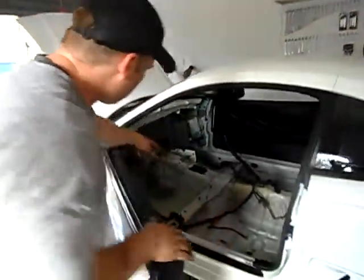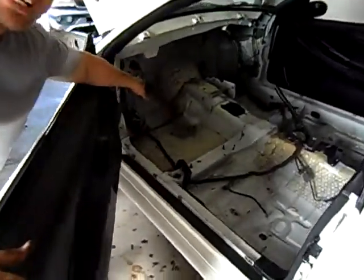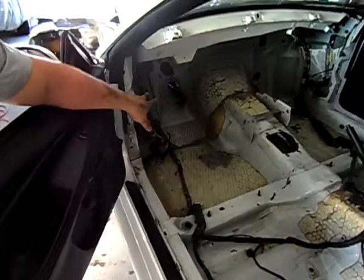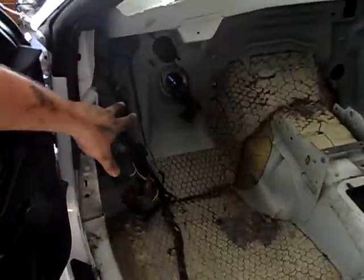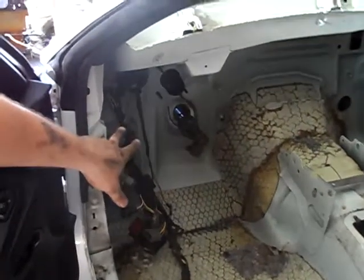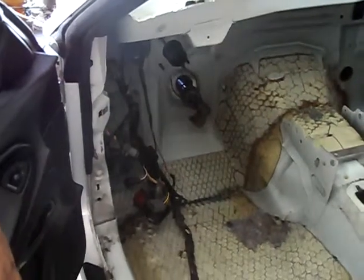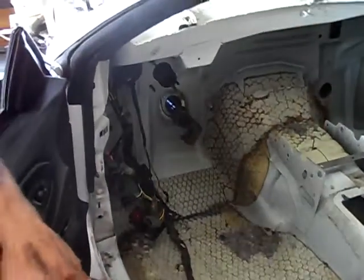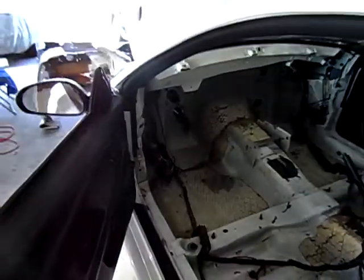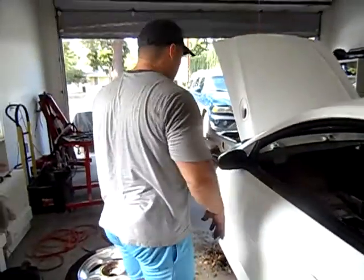We went ahead and completed pulling out the dash so we can expose all the wiring harness. I have to switch my pedal assembly as well, that's why that is removed, and at this point I'll probably order up a needle bearing steering column to help with header clearance and a few other issues in the future, and make the steering a little more precise. But again, the entire wiring harness is going to be removed. Then we'll pull it from that car and swap it in as a direct swap since these share the same chassis.